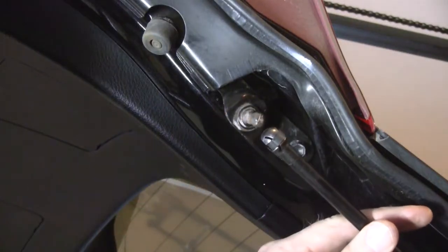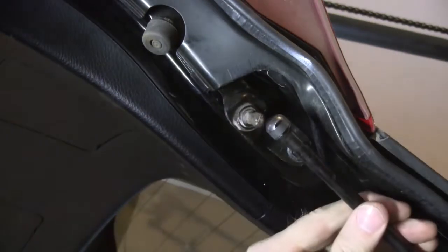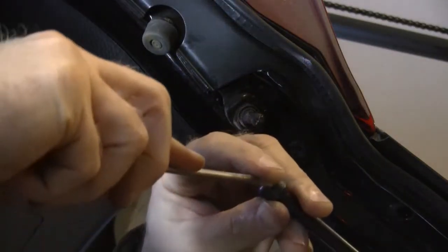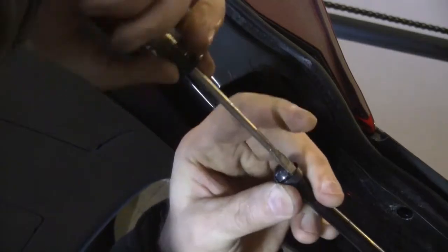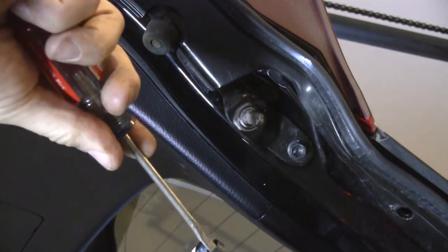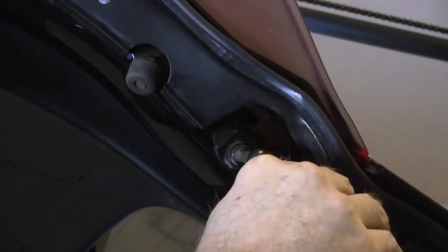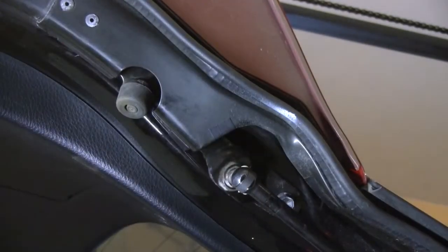Now we want to put this one on here. You can see it's turning the wrong way, so just grab hold of it and rotate it around so it lines up. We're going to do the same thing — put the screwdriver under the spring, which admittedly can be easier said than done. This end is a little tighter than the other one but works the same way. Just get it started under there, add a little dollop of lithium grease, and bring it up into place. My lift gate is actually just a little too high and it is heavy, so just bring that down, put it in place, push the spring down, and that's it. We are good to go.